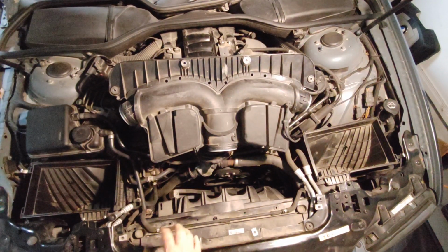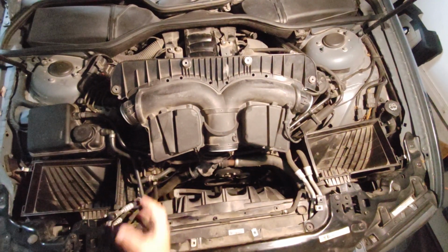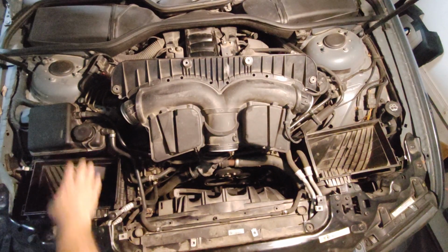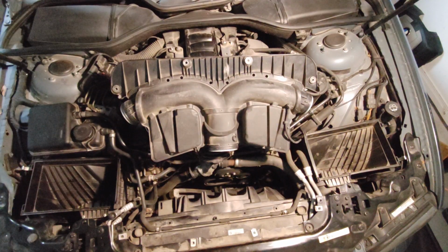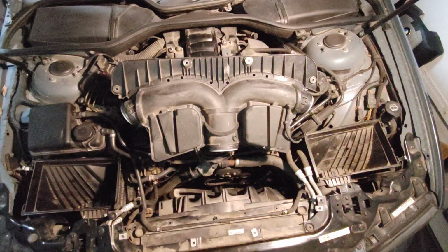So basically, this pipe has a lock mechanism at the very end, which locks to the housing. The lock never gets worn basically, but the O-ring inside, by the time it's getting old, gets worn and causes the leak. So for opening this, I need another T, which is TX30, it says. But anyway, you can find your own T.